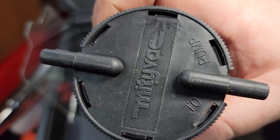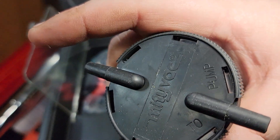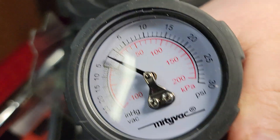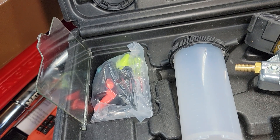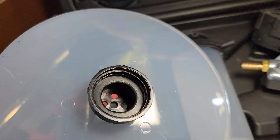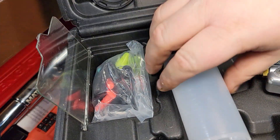You can see right here it says right on the cap 'to the pump' or 'out' - so this would be the hose that comes in from your caliper on your brake bleeder screw to the pump. What I would do is suck - put it on the same setting I have it on right here and suck the air through, pull a vacuum on the brake system with your cap on top. This splash guard sets over your master cylinder - it gives you three different sizes - and basically lets the fluid go down. It's great for doing brake bleeding.